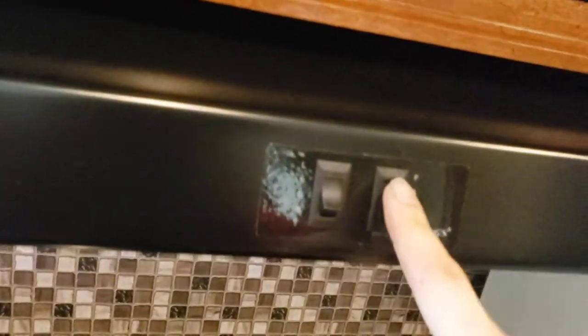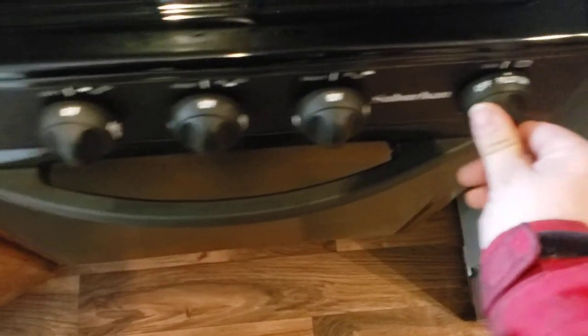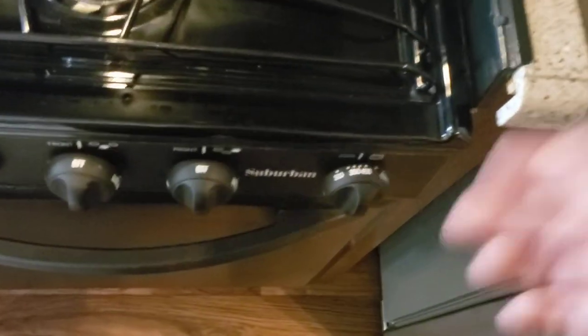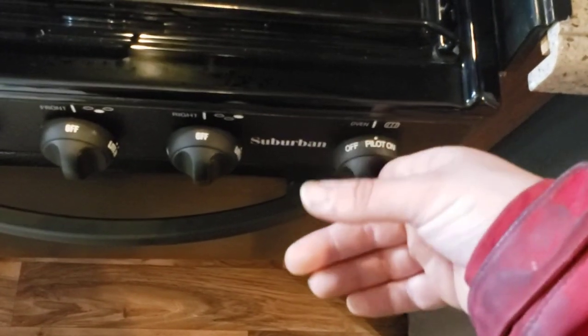Microwave — it's only going to work when you're plugged in. The range hood fan with light: if you're going to use this fan when cooking, make sure you have that flap on the outside open. Nice folding cooktop — this will act as a backsplash once it's open. Turn the knob and twist to spark it for the burners. The oven is a little different: you push and hold on pilot, then go inside and light the pilot using a barbecue lighter or a match. Once the pilot is lit, you can turn it from pilot to whatever temperature and it'll cycle on and off to regulate. If you know you'll use it again in a few hours, you can turn it to pilot-on to leave the pilot burning. I always recommend turning the pilot fully off before bed — you don't want a lit pilot overnight.